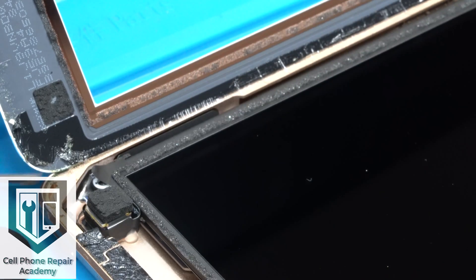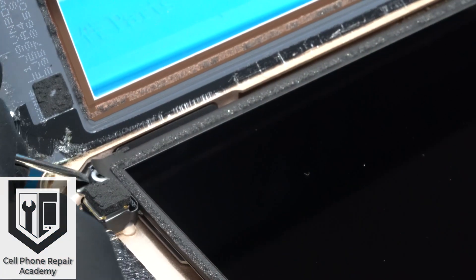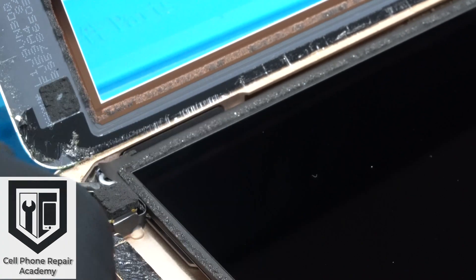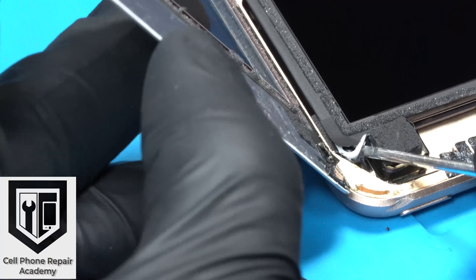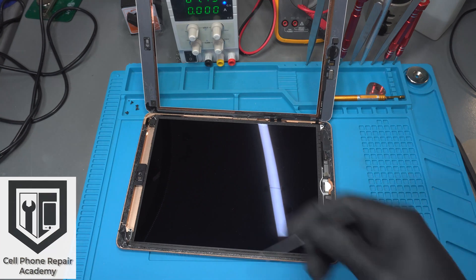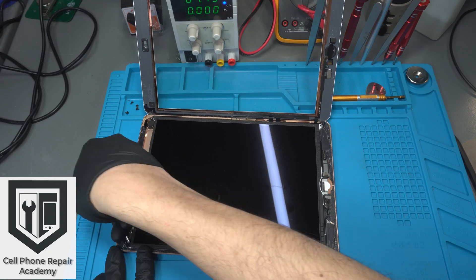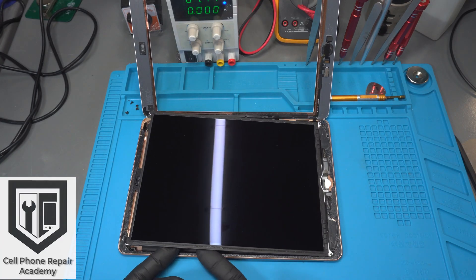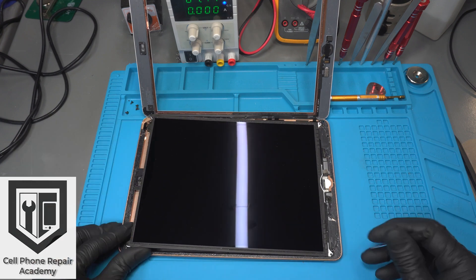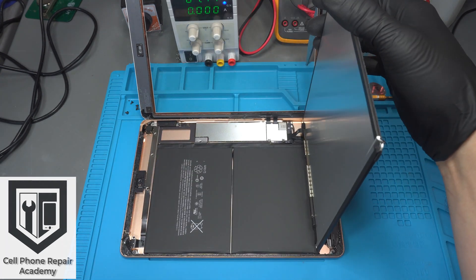After all four screws are removed, we use a flat head screwdriver on all corners of the LCD. We insert the screwdriver through the epoxy on the corner and make sure to dig in under the metal plate. The LCD is installed on top of a metal plate, therefore if the flat head screwdriver is inserted in between the LCD and metal plate, you are going to crack that LCD. Once all four corners are released, make sure to lift the screen from the left to the right to a 90 degree angle. If the LCD bends further forward, the LCD flex cable will rip and you will have to replace that LCD.